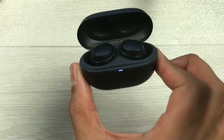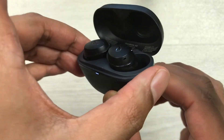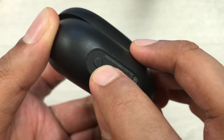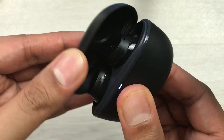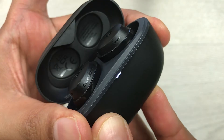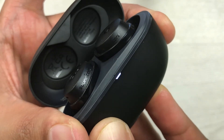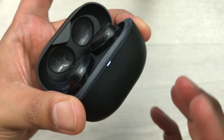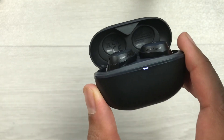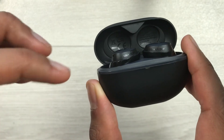On your charging case, close it and then open it again. At the bottom of the charging case you have a pairing button — press and hold it for 10 seconds. After 10 seconds the light will turn red and blink three times, then it will start blinking normally. Now you can leave it — the hard reset is done. You can now connect it with the same device or a new device, and your connection problem for only one earbud will be solved.